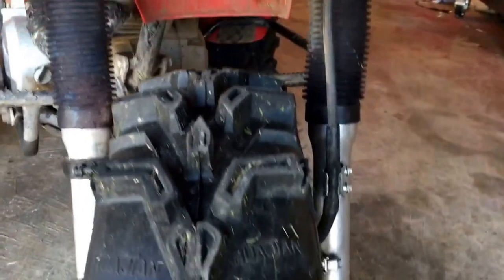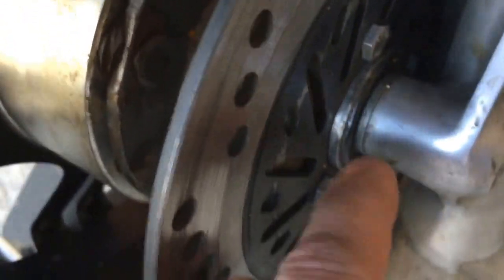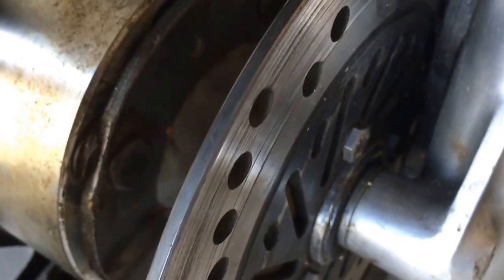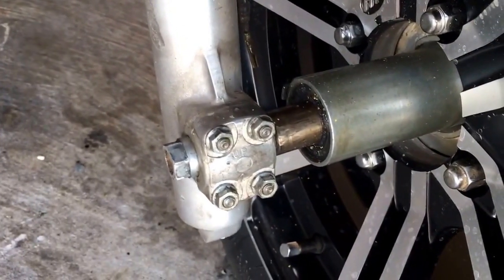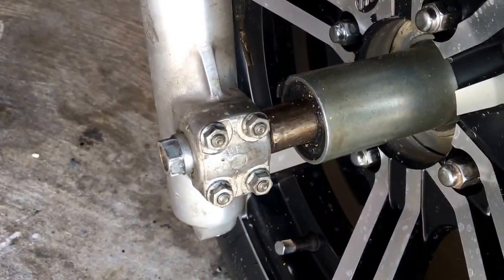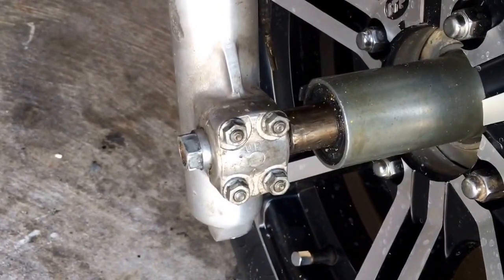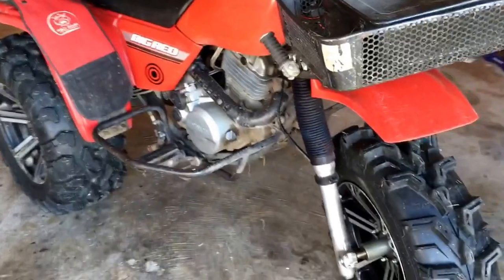Let me show you the spacing. Once I got the axle width figured out and knew what spacer I was going to use — I had to cut about three quarters of an inch off the spacer, what they call the big spacer on the front of the 350X — I cut that down to make it have contact with the bearing past the seal on this side. I took off my speedometer drive because I'm going to go with a digital one. This bearing is the same one you'll find on the front of your 350X or your ATC 250 ES, and the other side is just the regular plain factory spacer.